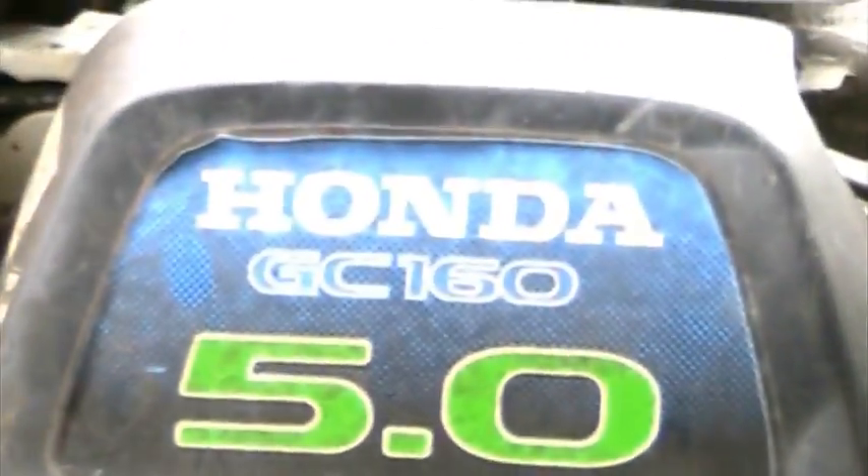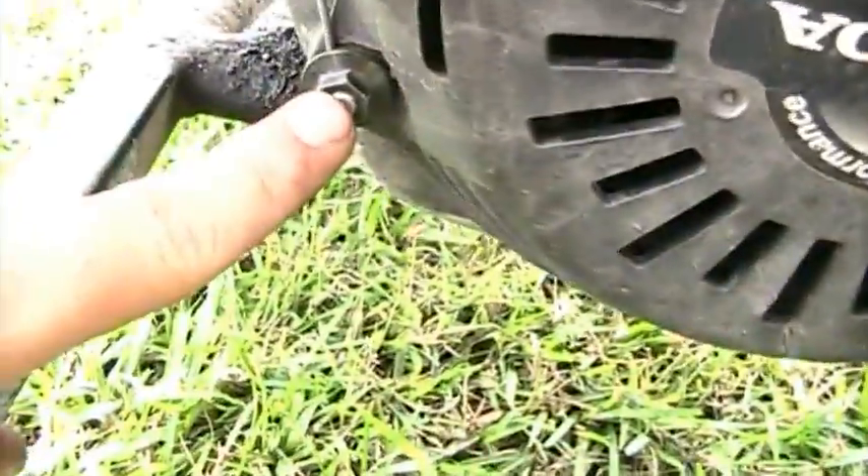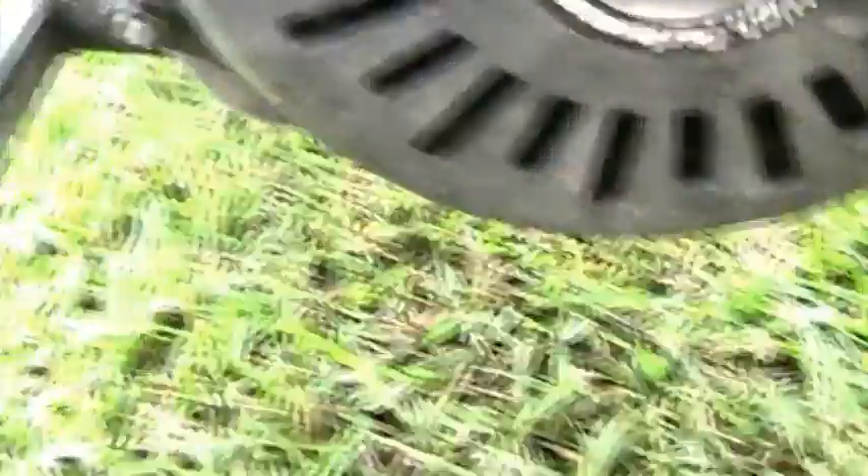Now, if you have a Honda GC 160 — it's a tiller engine, came off a Husqvarna tiller I believe — here's how you get the accelerator to work to make it a go-kart motor. For throttle return, you drill a hole through here and put the spring on, fastening it down to the frame if you have a dead axle. If you have a torque converter go-kart with a metal frame, pop your hole through the frame and hook a spring in like that. This way works — I can still pull over the motor.